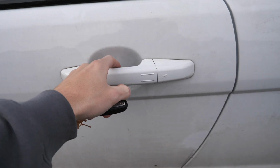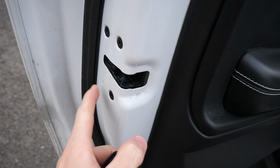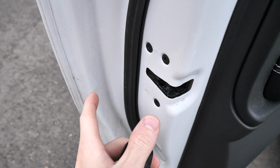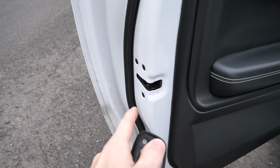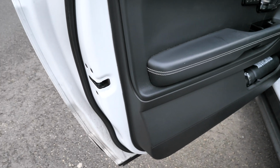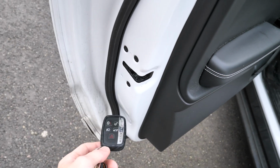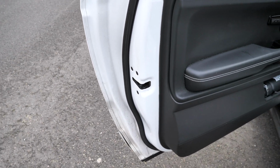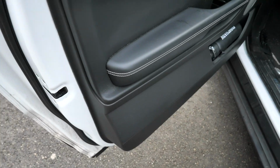This is what we're dealing with. So what I believe is to be the issue is this little puppy in here. So there's like a little solenoid that obviously when you lock and unlock your car, it will tell this to go right, lock, unlock, and that has failed, we believe. So I've ordered a new locking mechanism. This is quite common, so I believe that some people do replace these. I'll show you the one that I've bought. I'll link it in the description on what one we bought. So yeah, I'm going to show you how to take the door card off and remove this. So let's go.